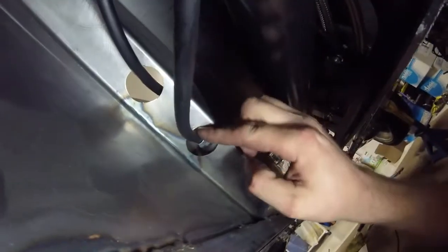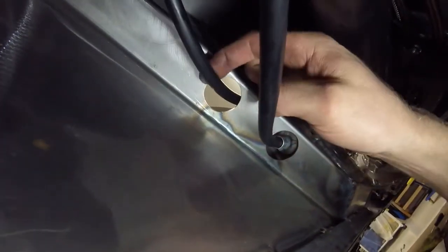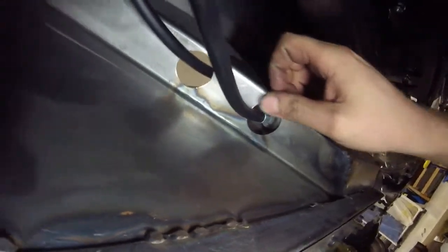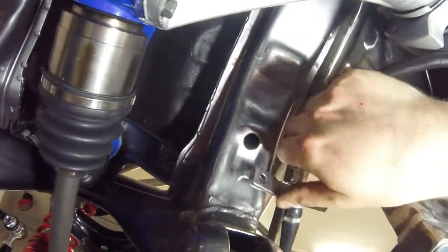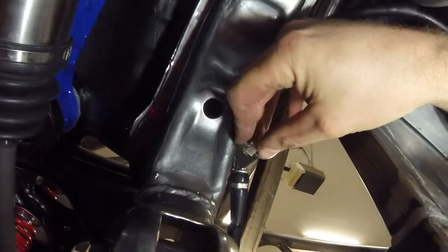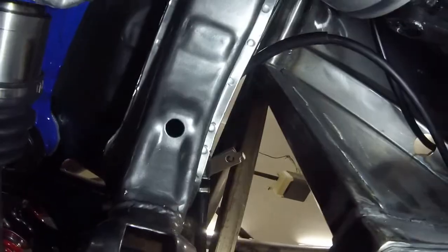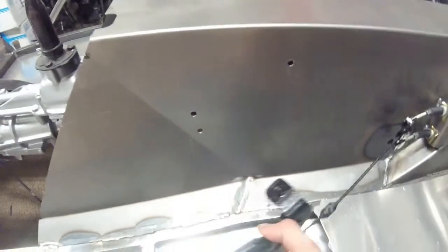The other thing you need to look at is getting some sort of grommet around the holes here to protect the casing on the cable, because as it is it's rubbing and chafing against the metal of the drilled hole. Once I tear it down I'll probably take some rubber grommet to put in there to protect that. I would also suggest zip tying the cables up or making some sort of mount to the frame or subframe here to keep these lines up out of the way.